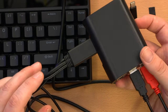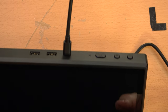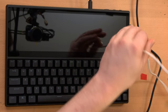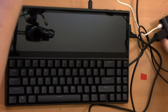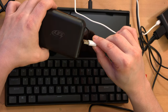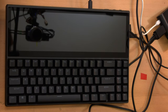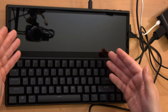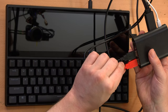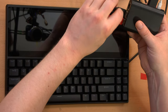For example, on the Raspberry Pi, plugs in right there, no problem at all — and it gives a fairly generous cable length. The USB-C plugs into the only place it can on the keyboard, the USB-C port. The only thing remaining for the Raspberry Pi is power. I'll use this white cable to distinguish it, and I have a separate USB PSU for that. So I'll plug it in, the Raspberry Pi will power up — and nothing happens. It gets no power at all. My assumption is the Raspberry Pi can't provide sufficient power out of its USB port to power the keyboard-slash-monitor.